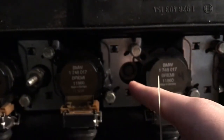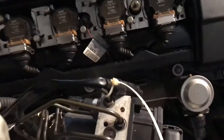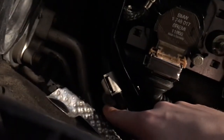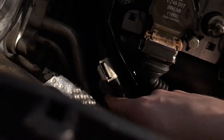If these bolts aren't torqued down correctly, that would explain all the oil coming out and being burned. One other place to check is in the back near the cabin air filter — there's a hard-to-reach bolt back there. If you ever change your valve cover gasket, be careful with that bolt because it's hard to get to and hard to torque down to the right spec.